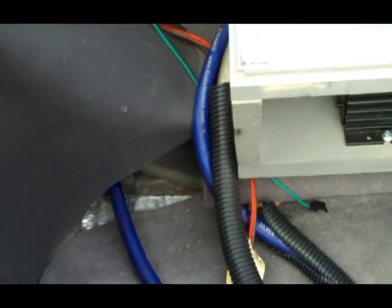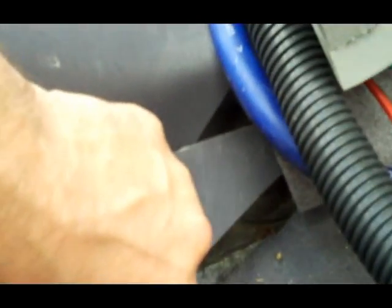The back seat is all laying out — that's the crap you've got to deal with. Remote wires, speaker wire coming up under here. I was having a problem right here — this plastic was right down on there and I was having to pinch my wire and force my finger through. Well, it turns out if you pull hard enough on plastic, it just breaks right off. Problem solved — a direct hole for my zero gauge. No more pinching, and it's better for the wire too.